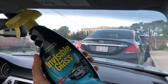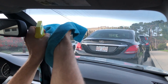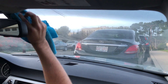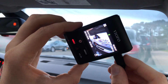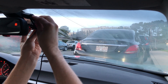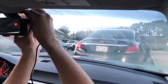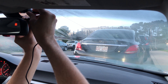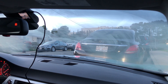A crucial next step is to clean your glass, and this is especially important for anyone using an adhesive solution like I am, since you want this to be a semi-permanent solution. Go ahead and take your glass cleaner and a microfiber and just wipe it down. Now take off the adhesive cover and position the dashcam as you had it — with the camera on so you can confirm the angle. Bring it over carefully, don't touch the glass to the adhesive until you know you're in a good camera position, then gently move it in to mount it on the glass.